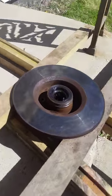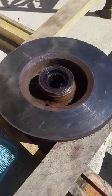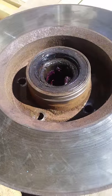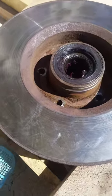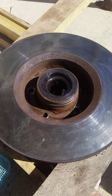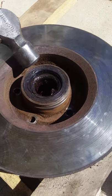After I watched his video I was like, oh okay. So what I did was scrub the outside of the wheel hub. It doesn't look like it because there's so much grit — it looks like one piece — but it's actually two pieces. There are five bolts and they are 14 millimeter. I looked up the specs: when you torque them down it's 33 foot-pounds, and obviously go in a star pattern.